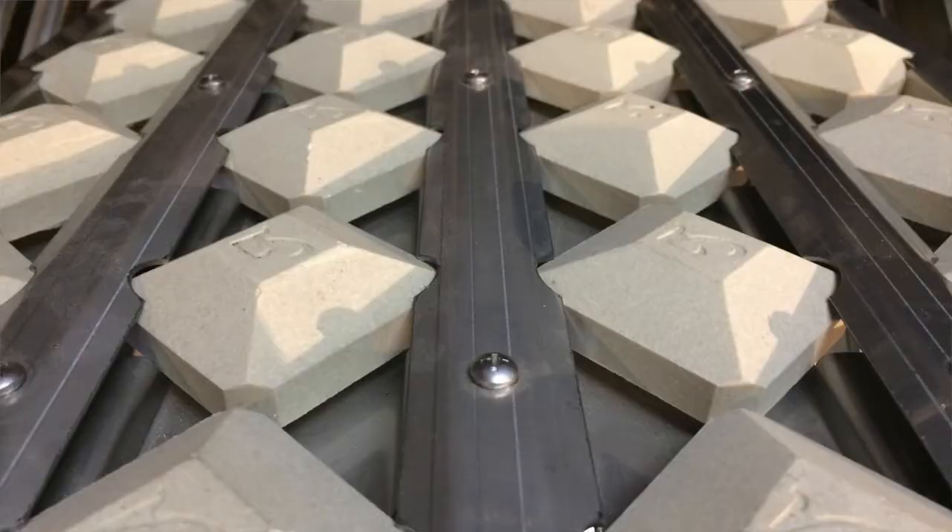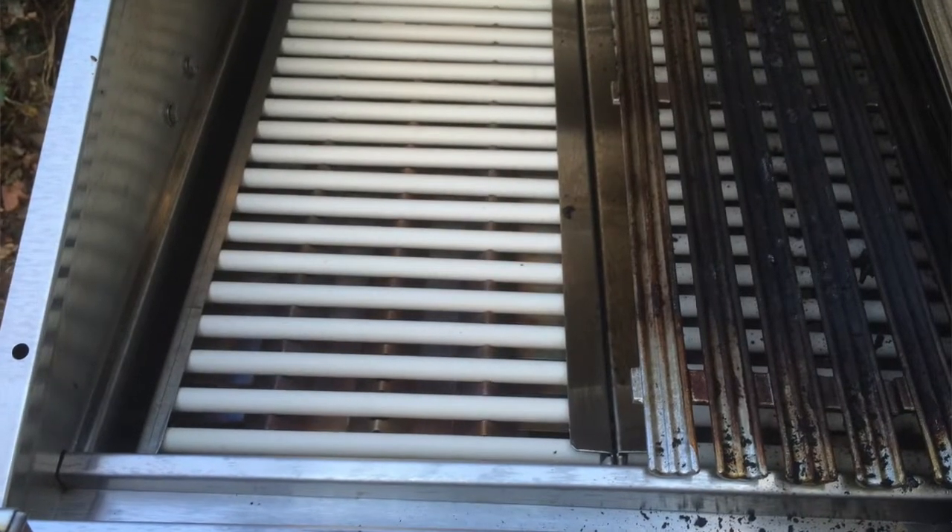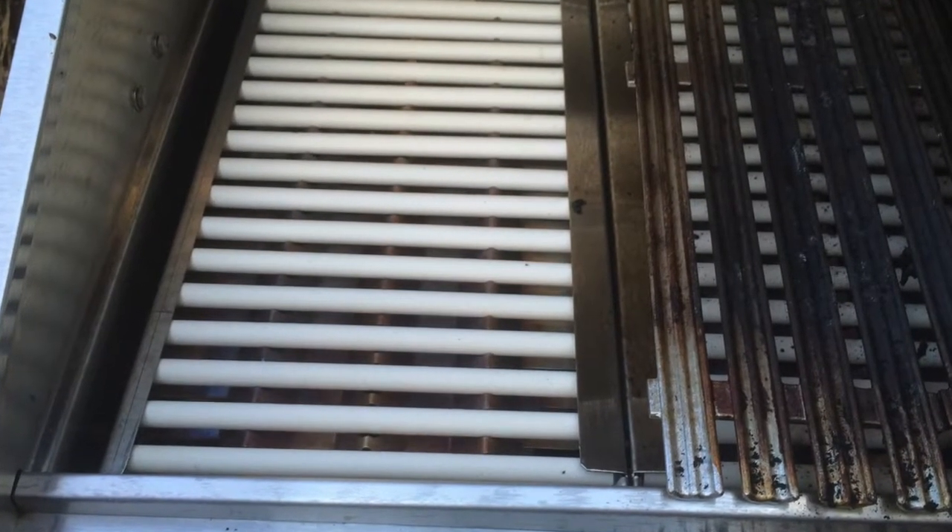One may be able to make the argument that the Alfresco is using a ceramic briquette system, and perhaps the ceramics are pushing some of that heat down — but I don't think so, because if anything, the ceramic briquettes are spreading the heat evenly across the cooking grates. Whereas the DCS is using ceramic rods, there is more room for the heat to come up. And let's not forget, DCS does have that heat deflector plate at the bottom of the firebox, which is probably pushing some heat back up.